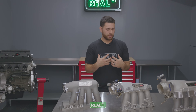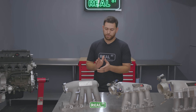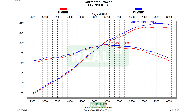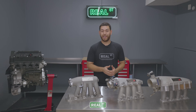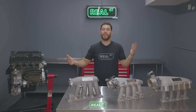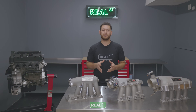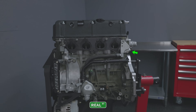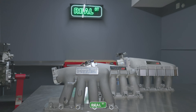What's the main takeaway with all of this? My personal view approaching this test was that with the largest manifold and spacer we'd see the most loss in power, and with the smallest manifold we'd see the most increase in torque — but that exactly wasn't the case. Being that the peak torque between the Pro Series and the Ultra Street were nearly identical, we looked more towards the horsepower and the power band as a whole. The Ultra Street does make more peak horsepower and actually carries a nicer power band throughout low and high RPM over the Pro Series. The Pro Series has a really nice space in its own way — if you want an OE-style replacement manifold and don't want to worry about buying an additional port for the coolant, and just want something that fits like OEM, the Pro Series manifold is definitely what you'd want to pick up.